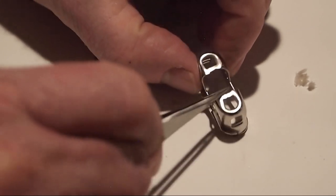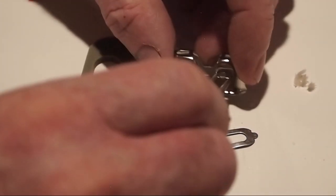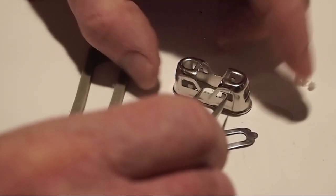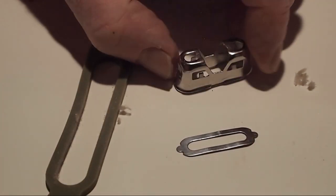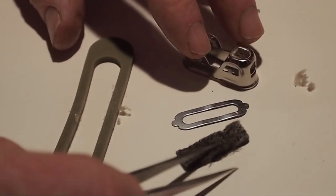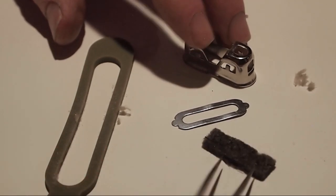to the generic Chinese heads. They're a little bit different. They don't pack as easily because they've got a big open space there. They use this retainer along the bottom to hold stuff in. And they've got a couple of tabs, which you can see here, which are bent down, which kind of act as a bit of a shelf to hold in the catalyst material, which looks like this, a standard Chinese catalyst. That's one that just came out of that head. It's never been activated. It's probably mainly iron content.